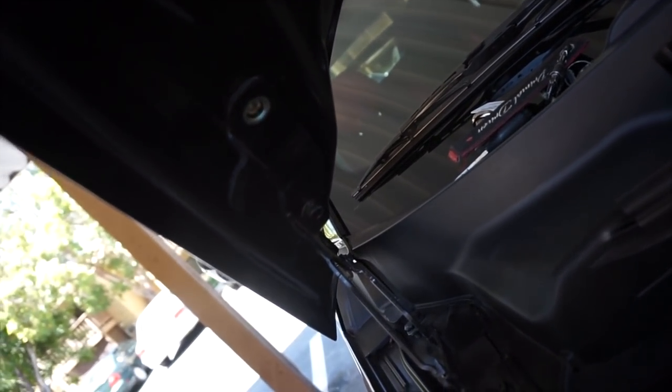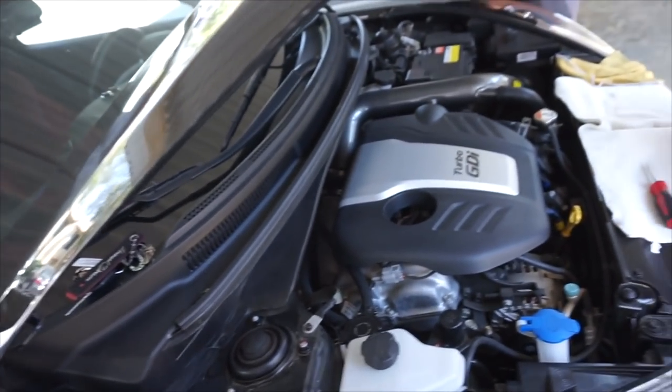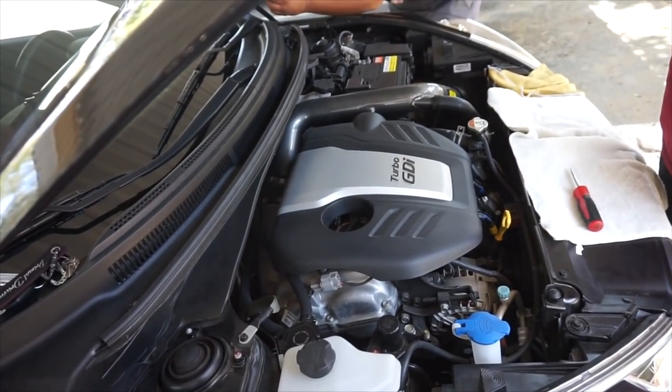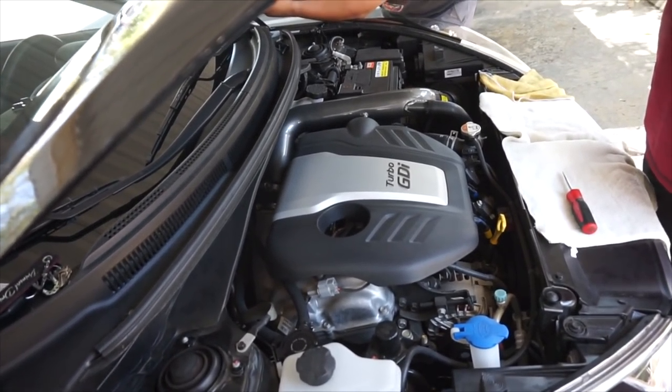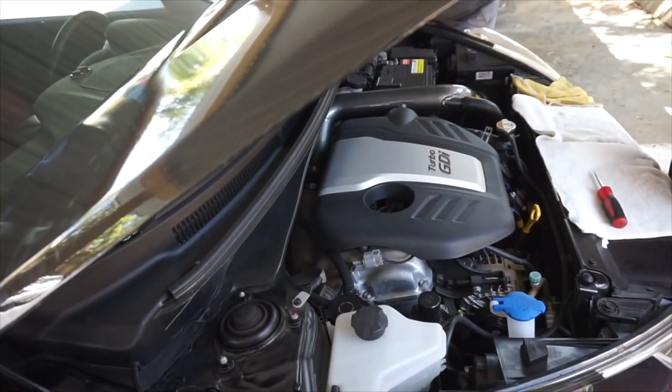Do the typical star pattern. Again, this is carbon fiber, so be really careful not to over-tighten anything. This is a little hard to record and install because we could really use the extra manpower, but I have my pops over here helping me hold the hood up. Carbon fiber is really fragile — it breaks and cracks easily.